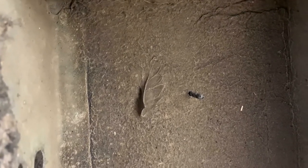And that will give me a 40mm hole around. And then I'll have enough room to get the second one in there. So that's really good. Okay, so we'll go through with the hole cutter now.